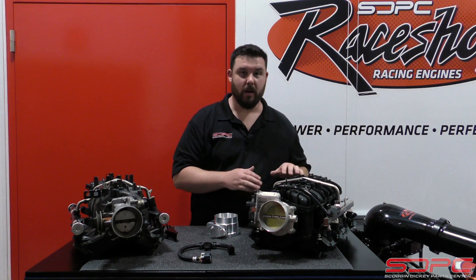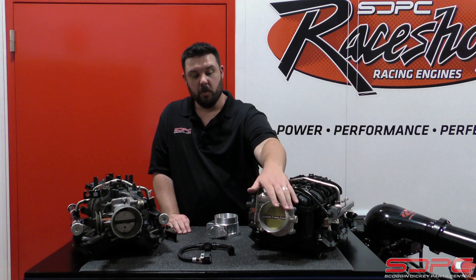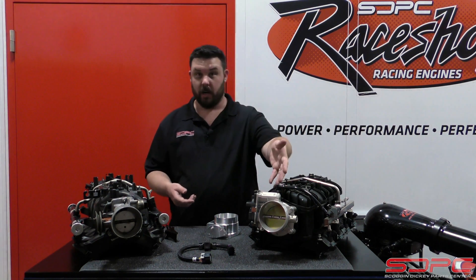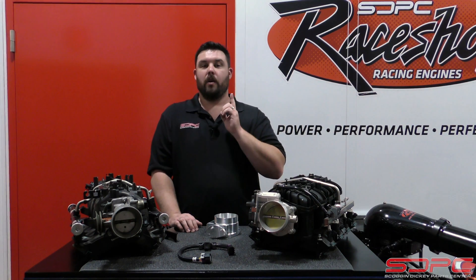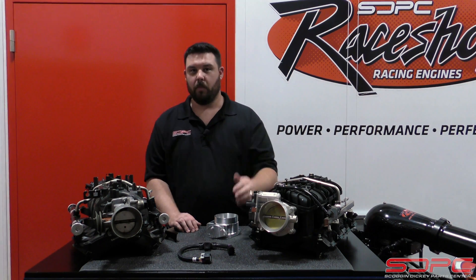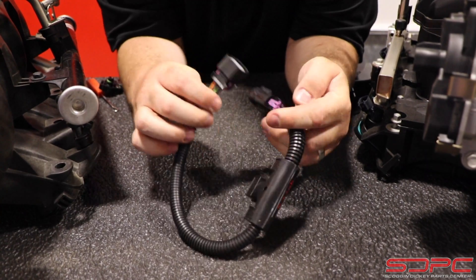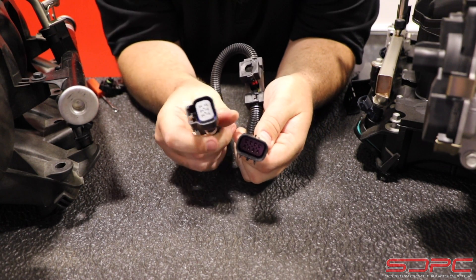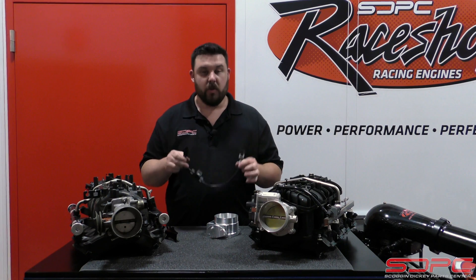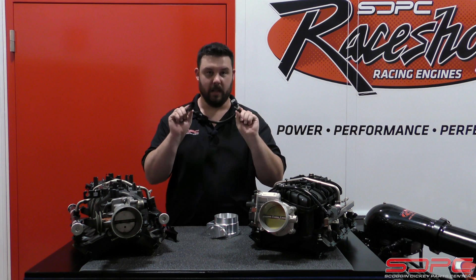Now for the drive-by-wire guys — your 03 to 06 Silverados — you are going to have to use the newer style intake throttle body. You'll have to use what most people call a gold blade throttle body, which is what you'd find on an LS3, the stock Trailblazer SS, or the newer style trucks. There is an electrical adaptation issue: you have a six-pin throttle body and an eight-pin harness. We sell the X-Link adapter that converts those together. You can't put a simple pigtail between the two — you have to convert the pins and the signal, which is what the little pill inside this container does. You do have to do some custom tuning to adapt all the signals, but this is the middleman that gets it all done.